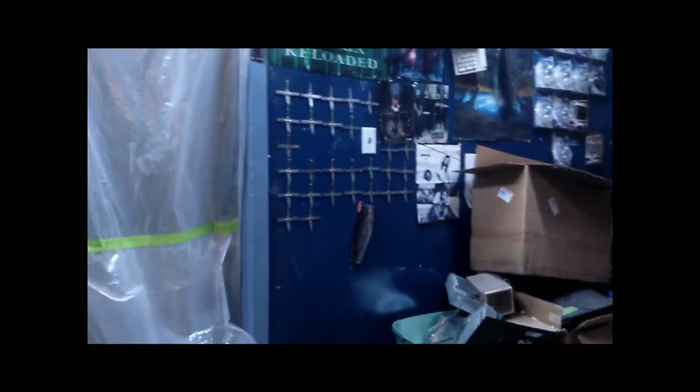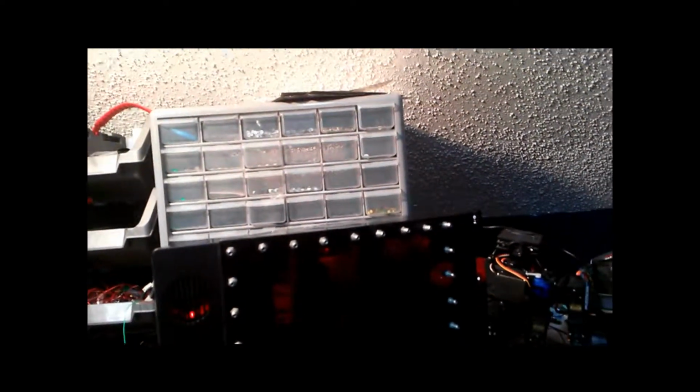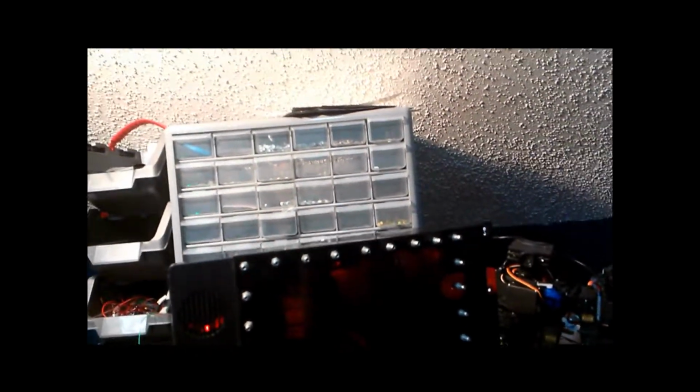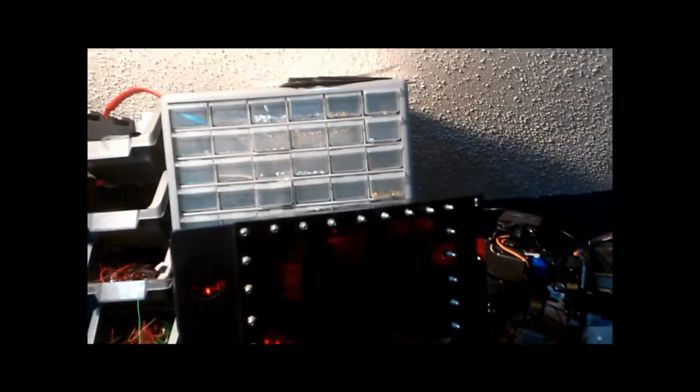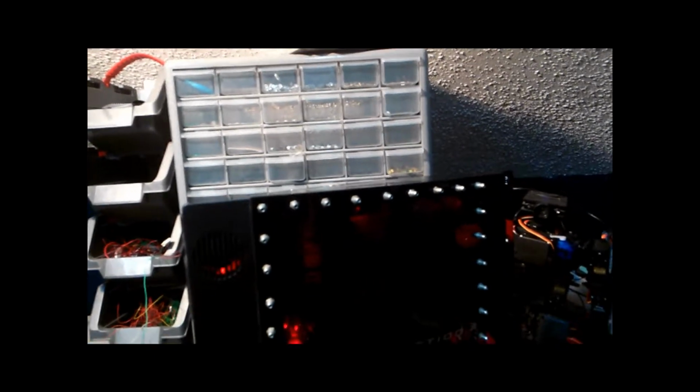And you can see my collection of clamps over there, and what it is is a flexible clamp that holds on the heatsink for your Xbox 360. And what most people do, and what I actually do to every system I've ever done or worked on, is take that off and do the red ring of death fix, but it actually helps prevent it from flexing on the motherboard. Needless to say, I've done it quite a bit.